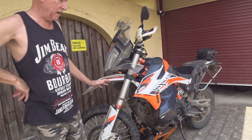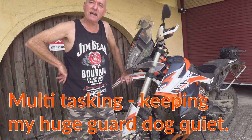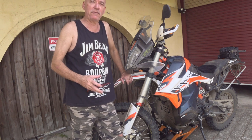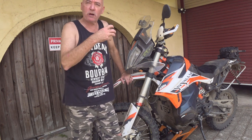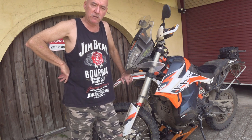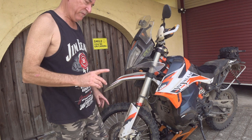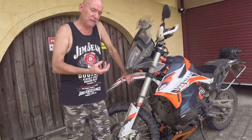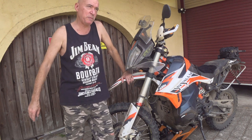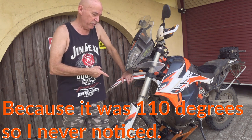As you can tell from the bike, it was a bit wet heading in there, and I made the cardinal sin with an 890 Rally of not wiping down my forks before I set off again the next day. That meant I had mud on the bottom of my forks, and with so many water erosion mounds graded into the road, you're continuously jumping and landing. On my brake side, I pushed some dirt up into the seal and made it leak, which on the ride home leaked onto my bash plate and all over the front wheel.